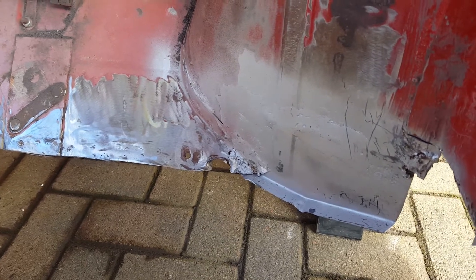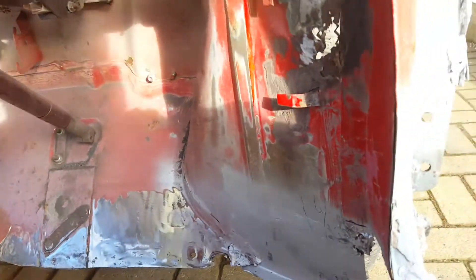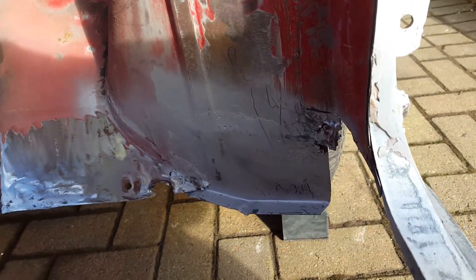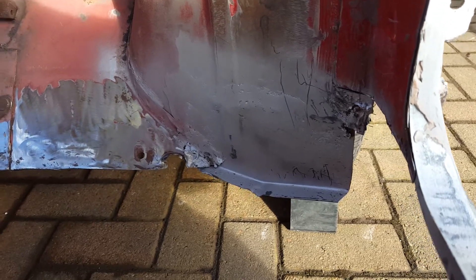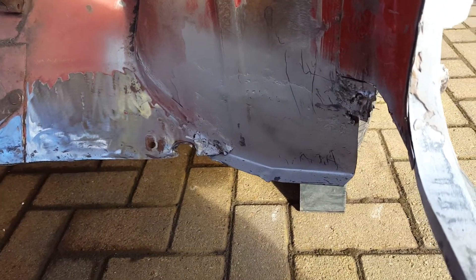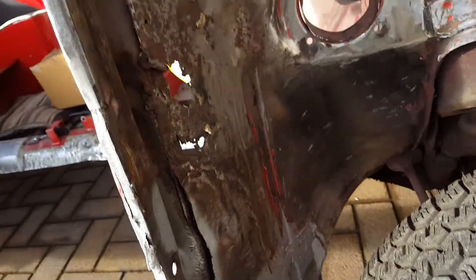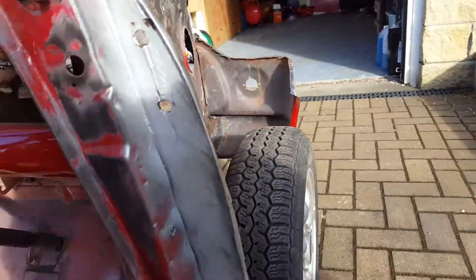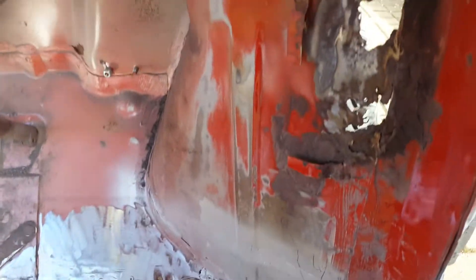When the floor is in, I'm going to try and attach it with pop rivets to get a close contact with the other sides before welding, and then keep some pop rivets in for extra strength as well. Obviously I couldn't just do it with pop rivets — that wouldn't be strong enough and it would fail MOT. This bit here, the whole inner wing, is pretty much destroyed all the way around, so that's going to be replaced once I've got a bit more strength into the frame. When I do put the floor on, the lower section of the inner wing I'm not going to attach, because this is all going to come off and I'm going to fit a whole new unit.